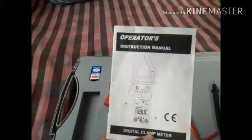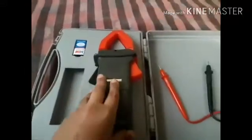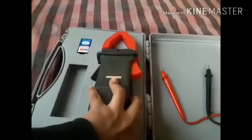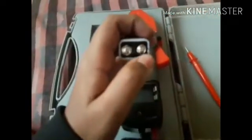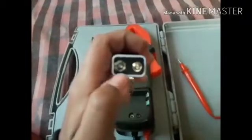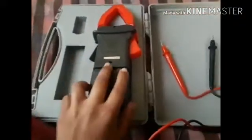The main thing is the device itself. Flip it at the back and you'll see the back panel — take it off like this. The smaller lead of the battery is the plus and the bigger lead is the minus. Put it in like this, then put the back cover on again.